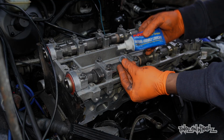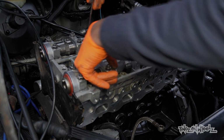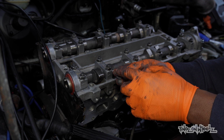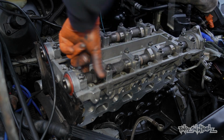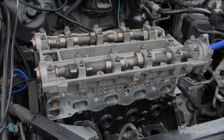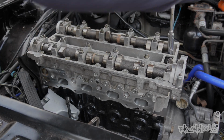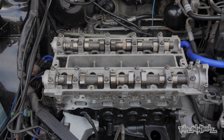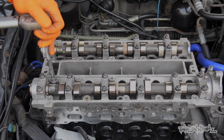The washers and nuts don't escape the lube treatment, and a telescopic magnet came in clutch, preventing me from raging. Then it's the tightening sequence, as per SBD's instruction. First stage, 25 Newton meters. Second stage, 47 Newton meters. And then the third stage, 81 Newton meters. Looking good.